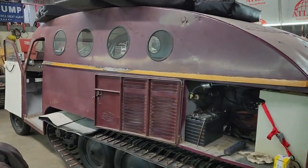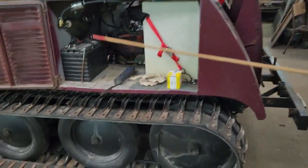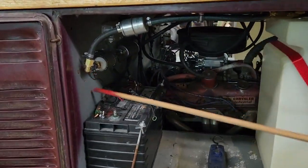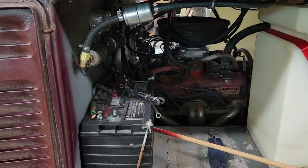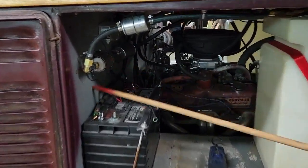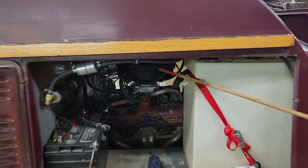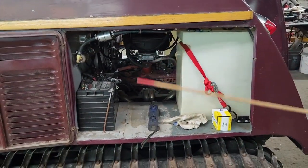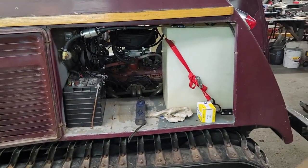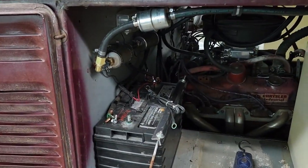So what are we missing on the Asham Bombardier? Okay, on Asham, I got a new switch here. I have to put it in here somewhere because this is where the battery is. But I want to make sure that this fuel pump works, being as high as it is. That fuel pump has to draw out of both tanks. So I don't want to put this switch in until I test this.